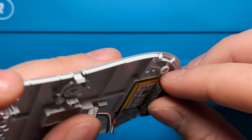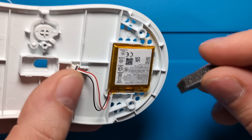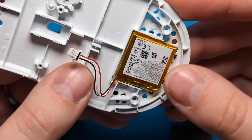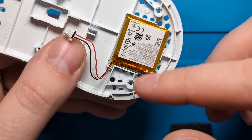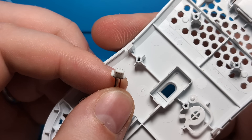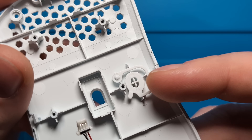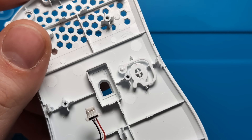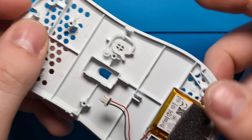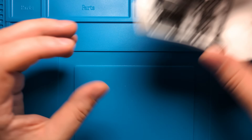We have a 306 milliamp hour battery here. You can remove the foam piece — I believe it's there for balancing — by gently peeling it off. The battery is in its own housing, so you'd need a pry tool to push from the back. I'm not going to remove mine to avoid damage, but if you want to replace the battery, get one of the same size and voltage with the smaller tri-pin JST connector. Also note: the contact for the base power and DPI button is melted down, just like the main and side clicks, so it won't fall out — a nice attention to detail.